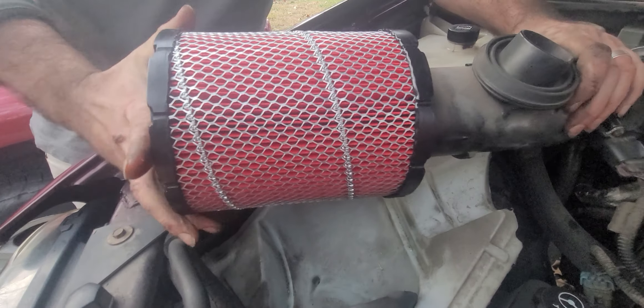Then you put it back, put the top back on, and bolt everything down. However, husband Kat and I are actually going to be hunting for a windshield wiper leak, which I ironically had in my Trailblazer because rats decided to chew through the little hoses. Husband Kat's new-to-him Trailblazer is leaking windshield wiper fluid. If you guys didn't know, underneath your air filter — which probably needs to be changed out — is your windshield wiper reservoir. So we're going to remove this stuff and see if there is a leak somewhere.